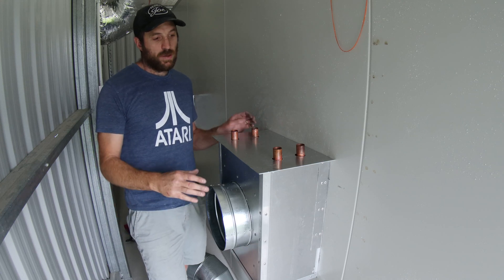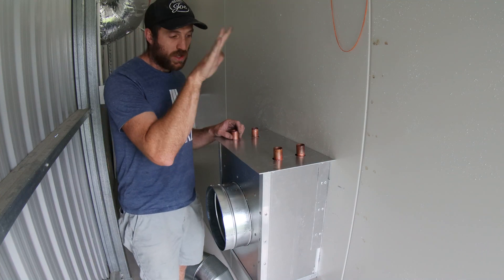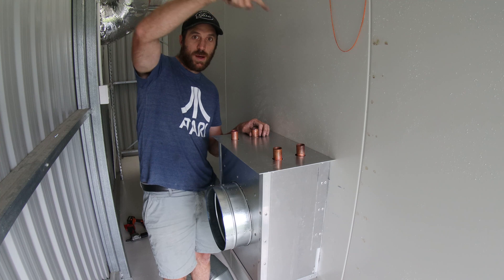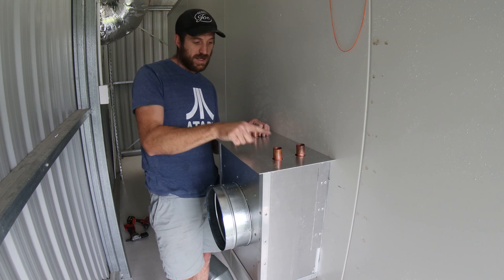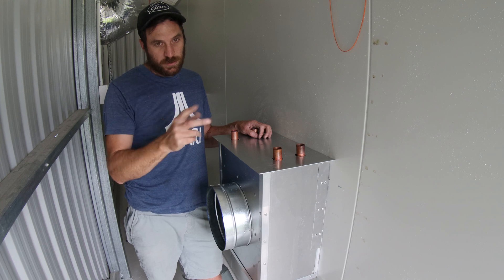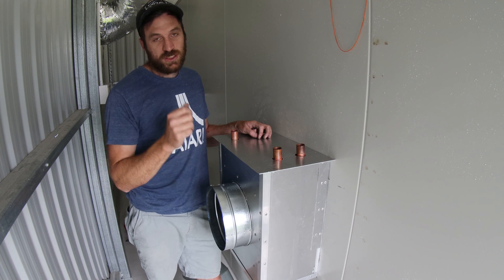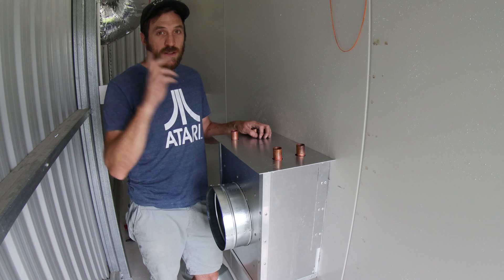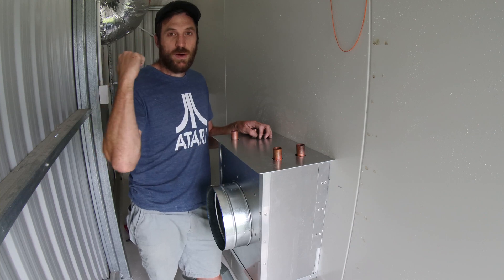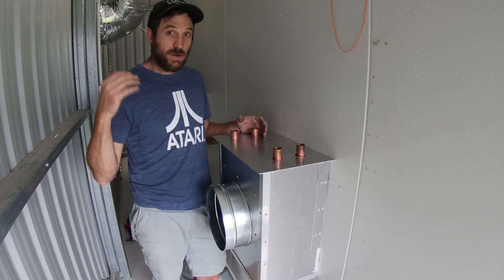A lot of this stuff I've never done before and I just sort of try and figure it out as I go. I've never had to join copper tubing before, so I'm going to have to do some googling to figure out the best way to join that. Ideally, it'll be joining that and changing it straight to plastic. The water will come in here, then it'll fly out here, back into there, and then out that one. Alternatively, I can only run one if I want to. I believe to make these air-to-liquid heat exchangers more efficient, you actually increase the rate at which the liquid pumps through them — the faster the liquid moving through, the more heat it can extract. So if I've got two in there, we can run that liquid through probably a bit slower and it'll be of the same efficiency as a single one running on a really fast pump.